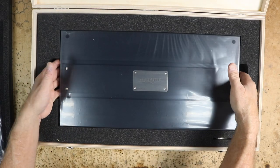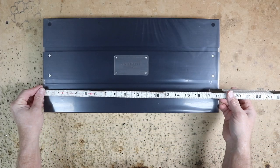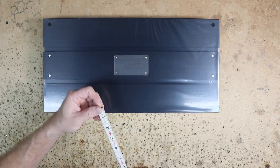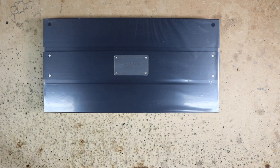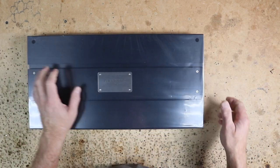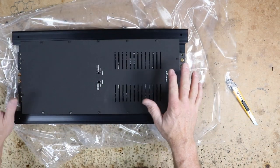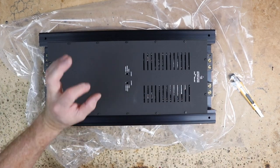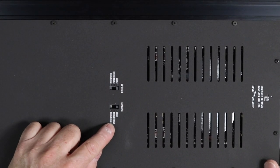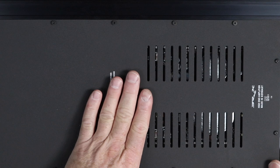Underneath is the gigantic amplifier. Also in the box in the corner is a set of allen keys. For those not up to doing the conversion from millimeters to inches, this is 18 and a half inches long, nine and a half inches wide, and two and a quarter inches deep — very similar in shape to the DSP. The way this amplifier breaks down: you have the power on one end and the speaker and RCAs on the other end. It has options for mono bridged, stereo bridged, or stereo for both channels one and two and three and four. We are going to be running this in stereo, so we can leave that in the factory setting.